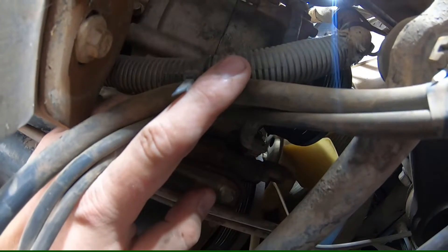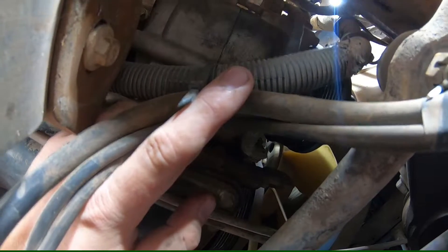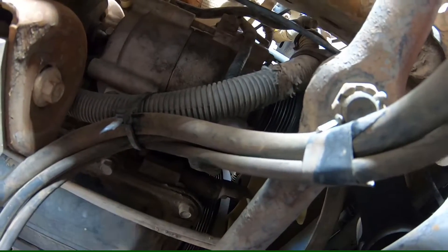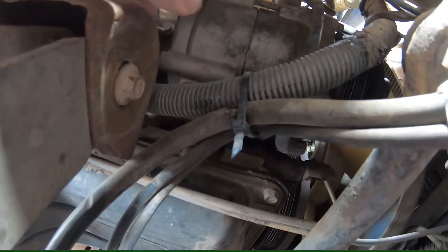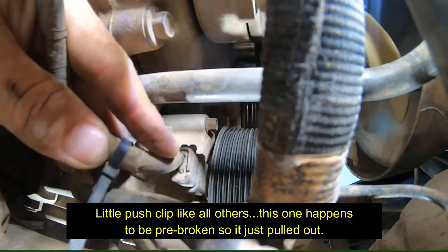As soon as you take these bolts off, you're going to have a wire attached as well as your AC lines. On this compressor you're going to have three bolts: one bottom left, one bottom right, one top right. Over here on the left, that's going to be holding your AC lines in — that's a 10 millimeter. Pull it straight up. Now your compressor is essentially disconnected — still have a couple threads holding it in place. We're going to figure out how to get it out — probably pull the fan off and go out that way.